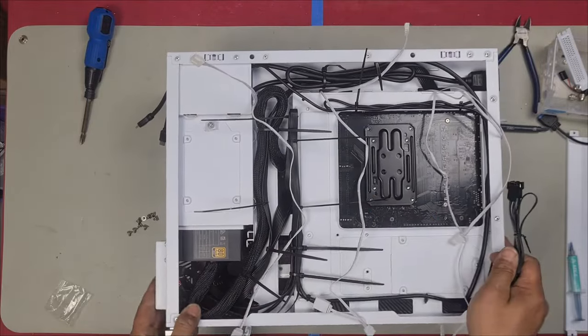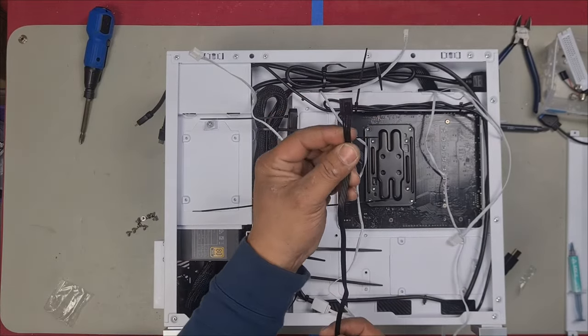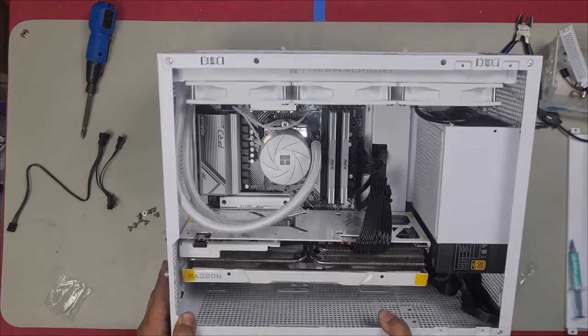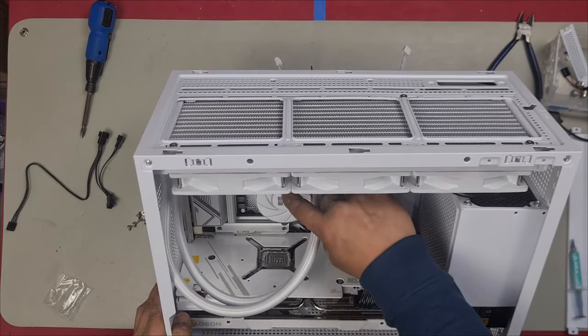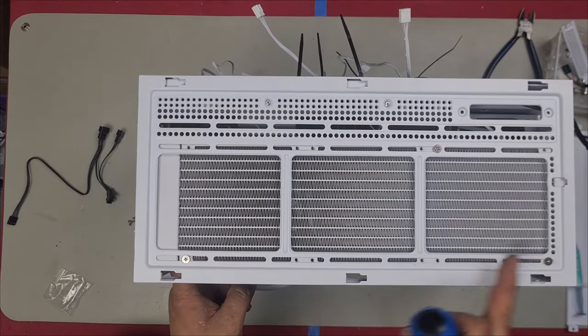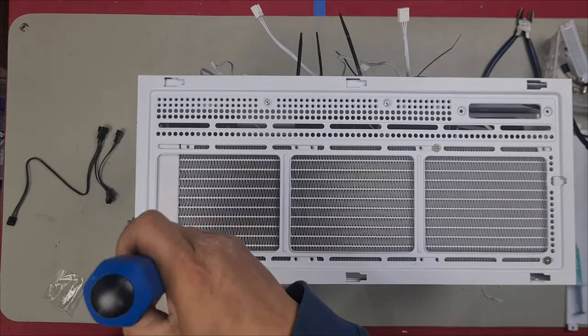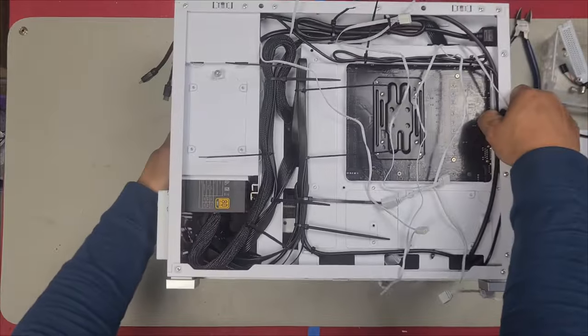They give you a splitter. It just makes it a lot easier to plug in all your fan cables rather than looking for a separate port for each. So this will go into one PWM connector, fan header connector, down the bottom here. I'm going to plug it in one of those. Our CPU fan here will run the one straight off the pump. That's better. So I'm able to push this all the way over and still be able to use the rear exhaust fan. With all the cables through, we can now plug in all our cables.